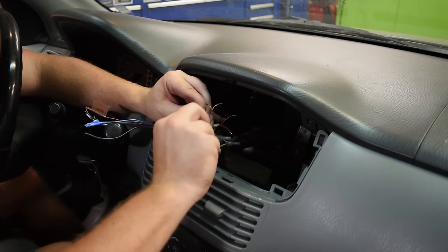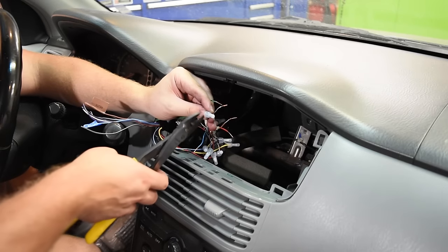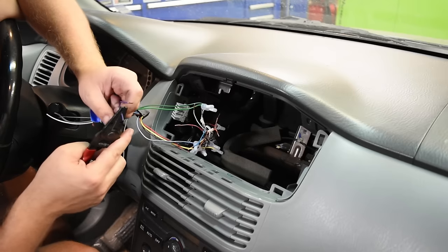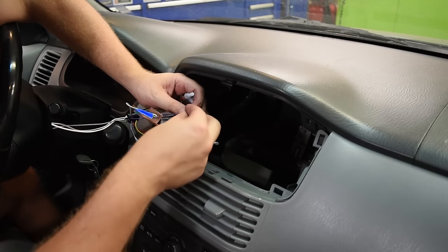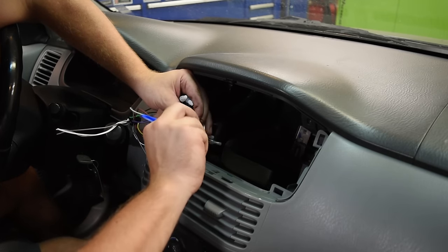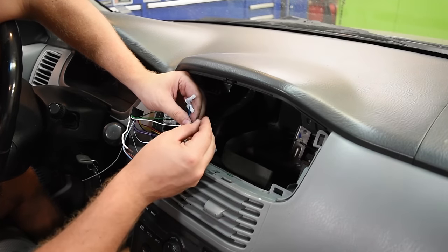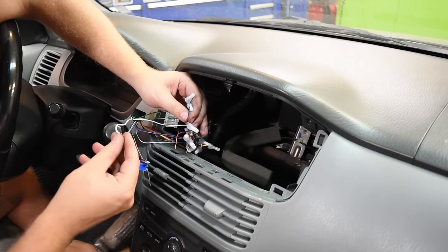Start with the blue and yellow wire hooked up to the green wire. Every car is different — just because these colors are what they are on a Honda Pilot doesn't mean it's the same on a Chevy Blazer or Ford Escort. Even through the years a 2010 Pilot might be different than a 2004 Pilot, so test each wire individually. There are lots of websites with radio wiring diagrams — I'll put links in the description below. You can hook speakers up backwards and still get sound, but it won't sound as good, so make sure each speaker is in phase.